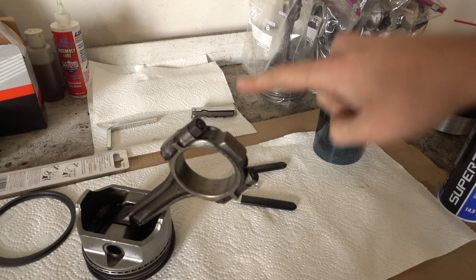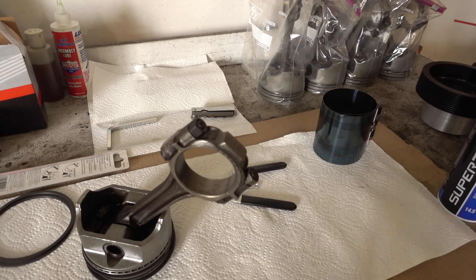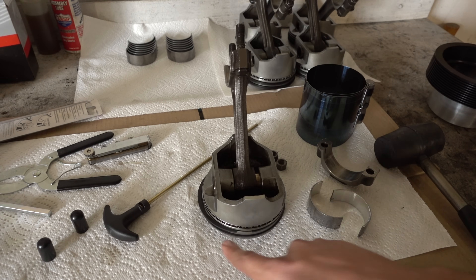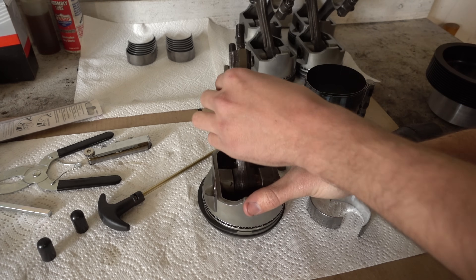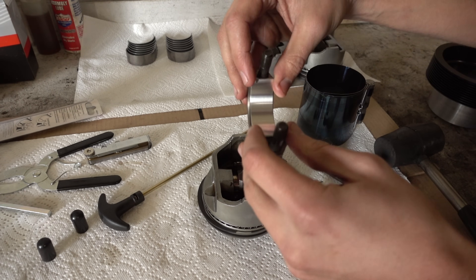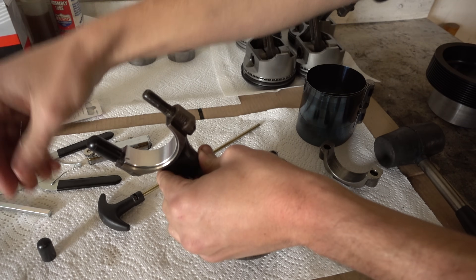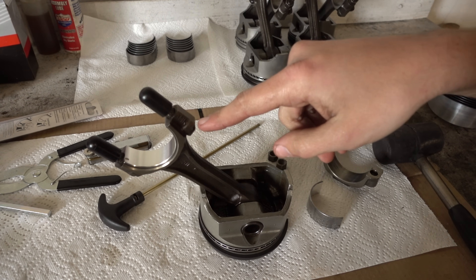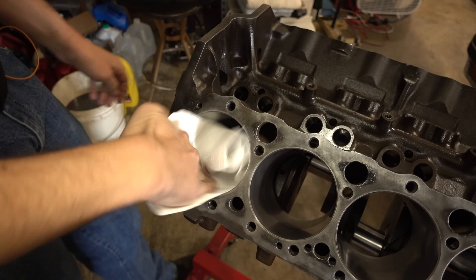Now I'll go through that same process with all the pistons. With all the rings on, making sure everything is clear and straight, the pistons will be fully set up and ready to install. All the rings are on all the pistons. I did have a few instances where rings were a bit tight in one cylinder but perfect for another, so everything worked out fine — glad I checked all those clearances. Now we'll take the number one piston, drop in half of the bearing, wipe off the bearings with brake clean, and put little vacuum caps over the bolts. I'm reusing the rod bolts and nuts.